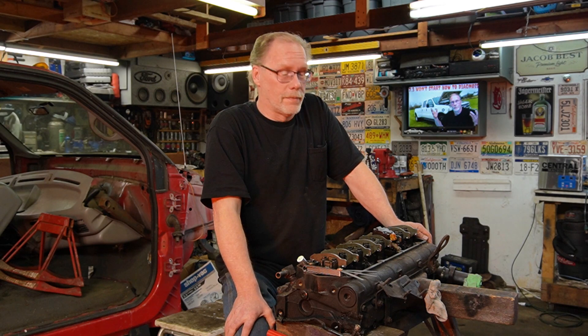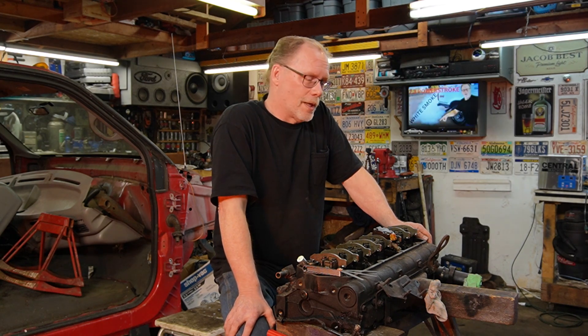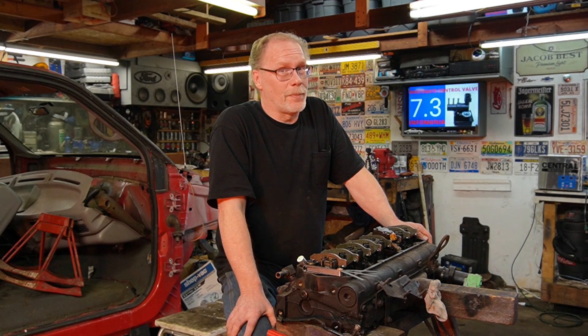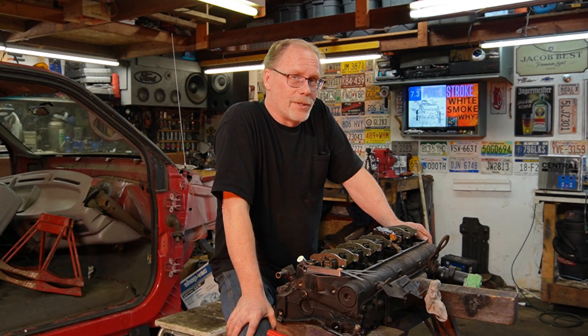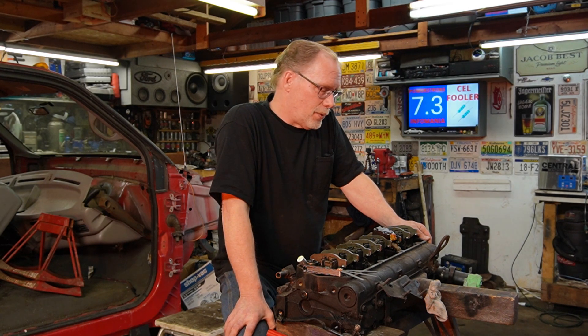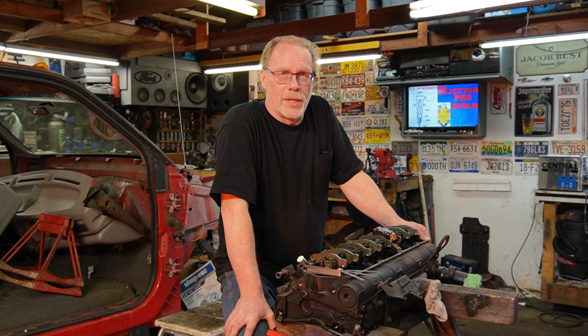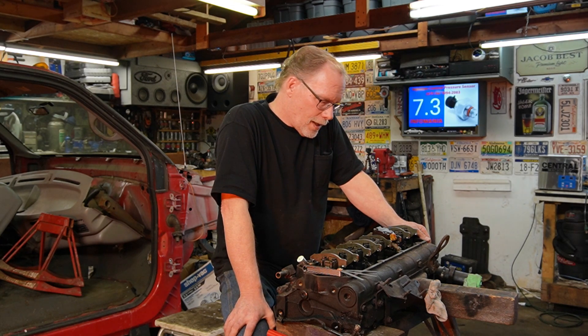I understand the ease of this — I honestly do. It's in the truck, pop off the solenoid, remove the armature, do your measurements, throw in a little washer. But then they say you're supposed to shim up the solenoid — that makes absolutely zero sense whatsoever. The factory says the maximum armature gap is 0.004 and you put on a washer and shim it up to that. Why would you shim up the solenoid? Makes no sense.